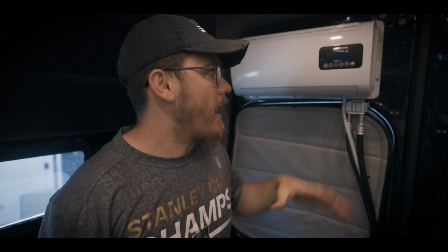So one way that I find to help run this during the heat of the day, if I don't have it on and let's say I want to turn it on, is I actually open my windows, I turn my two Maxxair fans on, I circulate a lot of the air, get air moving in here, remove some of that heat loading that happens when it's just sitting, all that radiant heat just baking in here, and then I run this unit, and it helps a lot. It's just like when you get in your car at first, it's actually better to just blast that air conditioning, let all the hot air get out, let it kind of balance with the environment, and then run your air conditioner, and then run the recirculation mode so that you're getting the maximum amount.